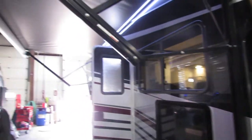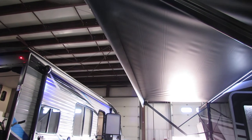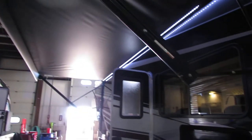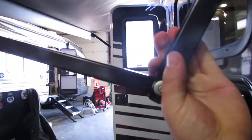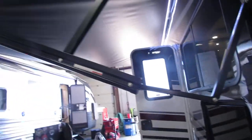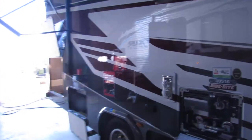First I'll start with your awning here. As you see, we ran this out until your flap is hanging straight down — that's when you know to stop. To adjust your pitch, you're just going to simply pull down just like so, and now our pitch is set. When we're done, we're just going to hit the retract button and the awning arms are going to fix themselves, so you won't have to push it up — it'll correct itself.